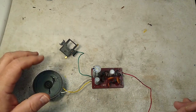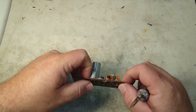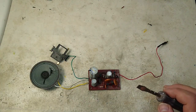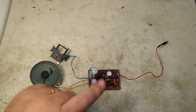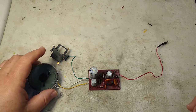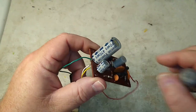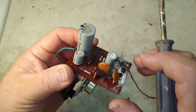It's possible that the board is blown. And if that is the case, unfortunately I don't have good news for you. Replacement boards are not available. This part has not been made in 40 plus years, and I know of no parts supplier that still has some in stock. You might get lucky on eBay or at a show finding a stray tender that has a board that works. The other option is, if you are better at electronics than I am, try to trace down the circuit and replace components with similar components until it works.